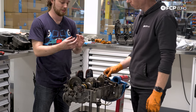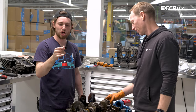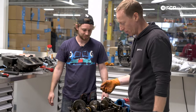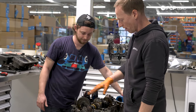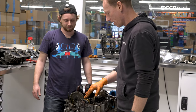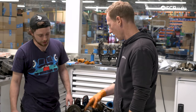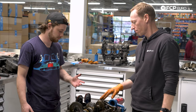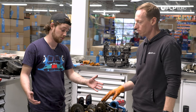There it is — the cam plug, the whole reason I took this whole thing apart. Garbage. The classic two-dollar part for a twenty-thousand-dollar rebuild. The crankshaft and camshaft are very direct drive — literally no way for that to fail unless there's some big problems. The camshaft also drives the distributor via a distributor gear. And this is your windage tray — a baffle. Typically these don't come with seals on, people forget them all the time, so it's nice to see this one has it.